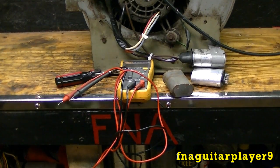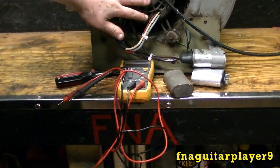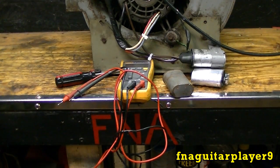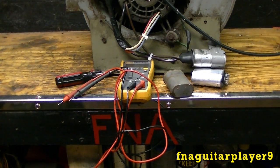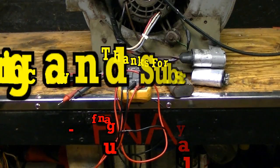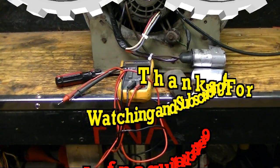That's about it. This is a very important thing that's often overlooked when you have a motor problem. Most people think it's the motor overheating or something wrong with the motor itself, but if you let it go long enough then you will develop an actual motor problem. A lot of times you can fix it just by replacing the capacitor. As soon as I replaced the capacitor on this blower, it ran like a brand new motor and didn't get warm at all. If you have any questions or comments, feel free to leave a comment below or send me a message. Thanks for watching.